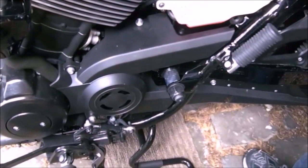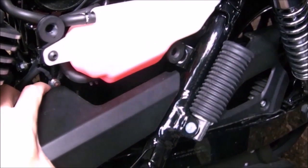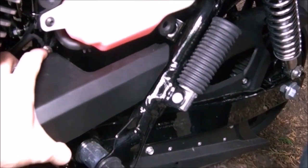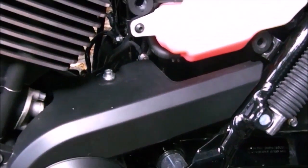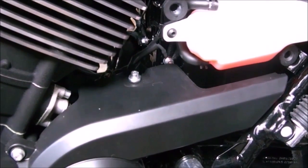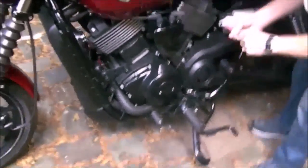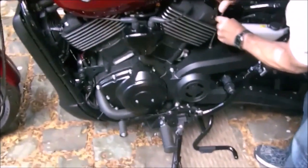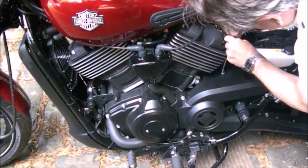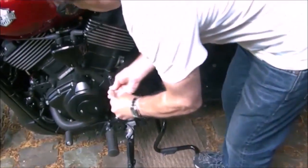So what you have to do as well is take off the belt guard, the front belt guard, because we need to get to this nut here which is the negative strap — it's tucked down behind there. That's the cold water bottle feed coming down there and around there. We've got a video for putting this on; now we're going to have a video for taking it off. It's five mil Allen bolts — one, two, three, four. Watch for the washers. Just whizzing those undone. This is still the easy bit. They're all the same length, so don't worry about which one goes back in which place.